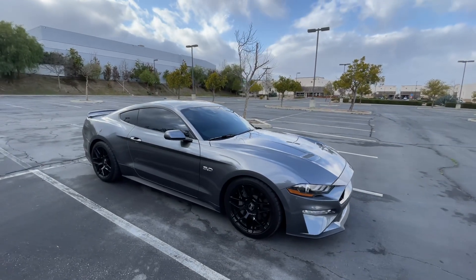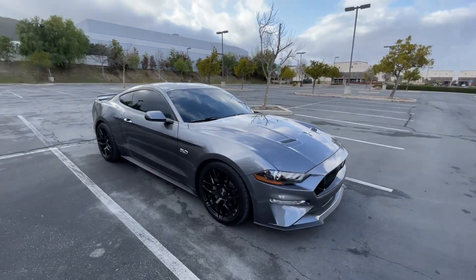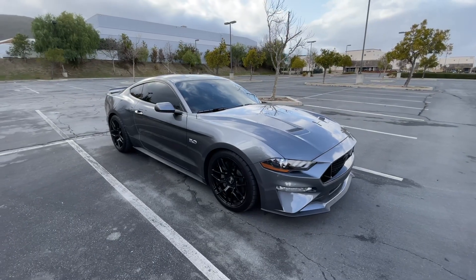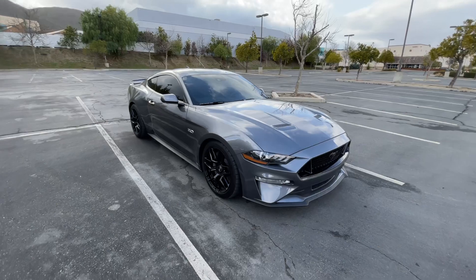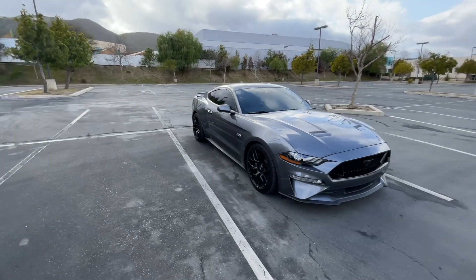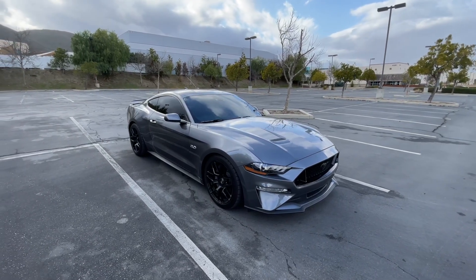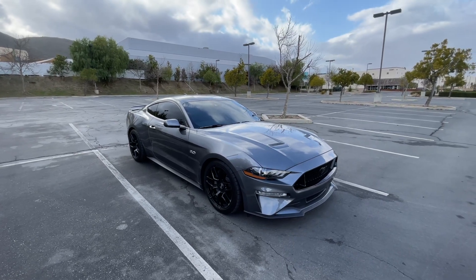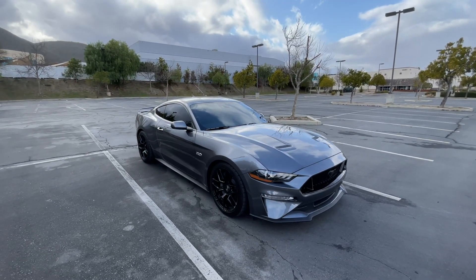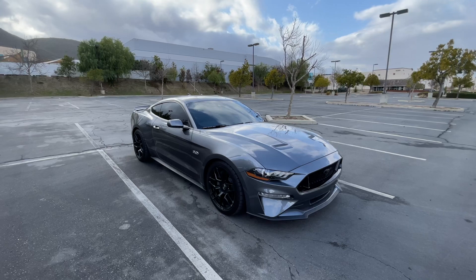Now getting out of the way, let's get into it. I'm going to be talking about performance. Going straight into it, what we have done is I have a flex fuel tune from a local tuner here in Southern California. Flex fuel means E85 and 91. Stock numbers on this car — I went from 373 wheel with no tune, nothing at all. Then we did the 91 tune and went from 373 to 390 wheel. Then we drained all the 91 out and put in E85, which is a hundred-plus octane, and we got 420 wheel horsepower — and that is just with a tune, no bolt-ons whatsoever added to the car.